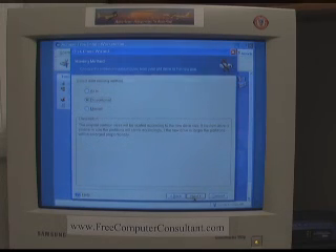Here you can select the moving method as proportional, meaning if you used half the old drive as one partition and half as the second partition, it'll do the new drive the same way — 50-50 or 75-25, whatever, in proportion. Or you can use as-is if you just want that 160-gig partition on the new drive with some free space left over. Or you can do manual. Proportional would work here because it's the full drive, but we'll just click into manual to see what's going on there.